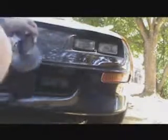So I figured I'm going to go ahead and keep going with this same piece of paper and get this real good. Get all these little striations out and all these other little things out of here. So you can see these little cracks, these little crack marks. They're all around this front bumper. They're in the clear. So I just take the DA and I can get those things right out of there. I'm just going to DA them all out.